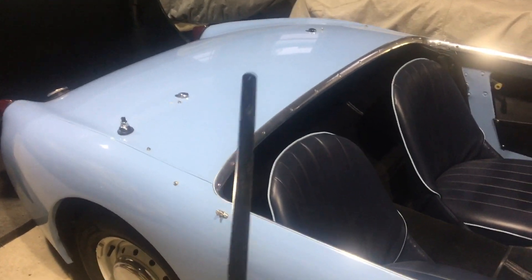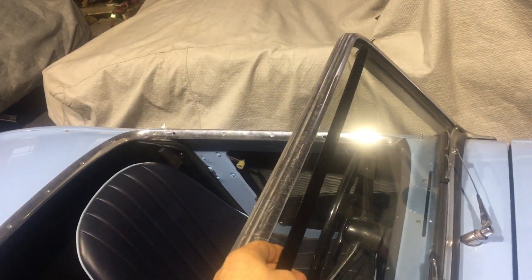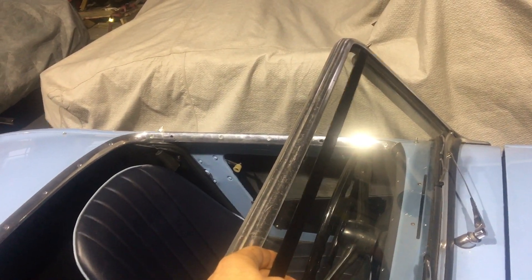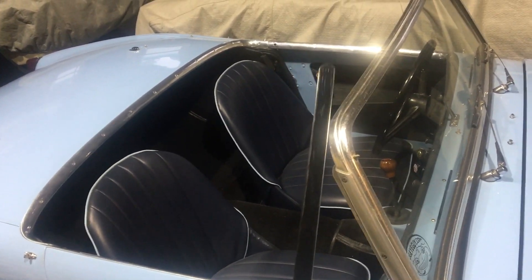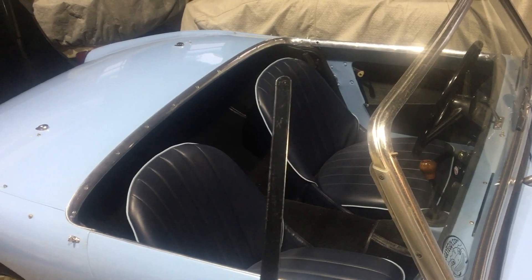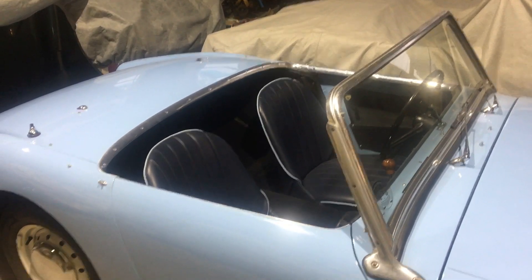The straight bar, where the ends look like this, is a little narrower and fits into the windshield frame — these are for the front of your top. A lot of cars we see have too small of a bar in the front and it becomes really hard to get the top to fasten. So if you're having that problem, it's a good idea to get a new top bar. We have all of this stuff for sale in our store at Bug-Eye Guy Parts dot com.